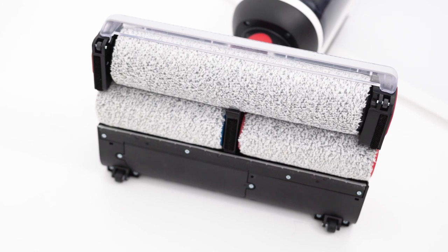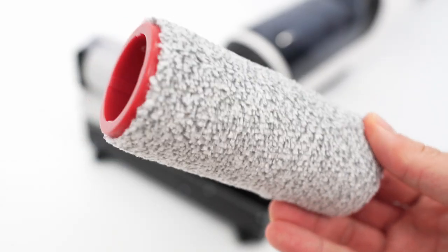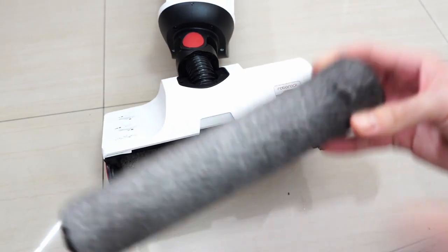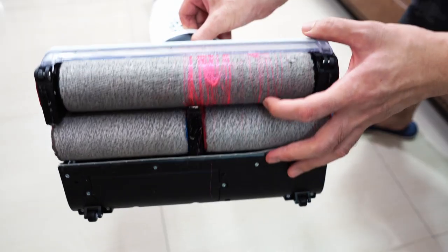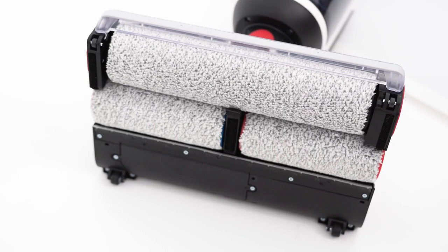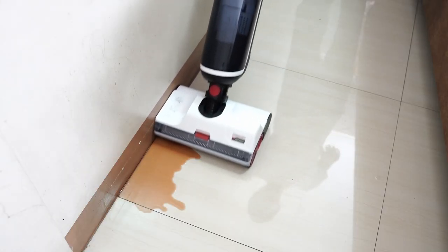There's a huge risk of the floor warping if you use it on porous surfaces because moisture will seep through. The Dyad has three rollers, giving it excellent agitation despite the low airflow. These rollers are thick, which is enough to resist tangles from stray strands of long hair. But it lacks an active anti-tangle system, so large quantities will wrap on the rollers and axles. The two back rollers go all the way to the sides, helping it pick up liquid along the edges.